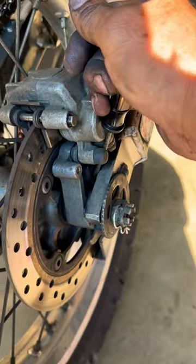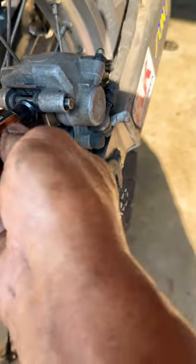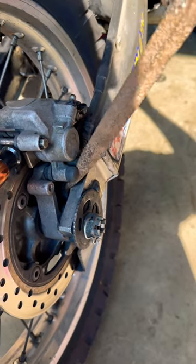If not, I'll take something right here and pry in. If I get enough space, I'll slide the caliper over like that, put this back here, put the spud wrench in like this, and pry the caliper to push the piston back.